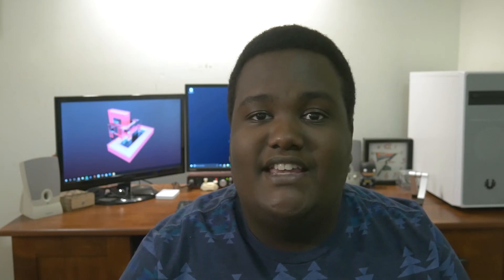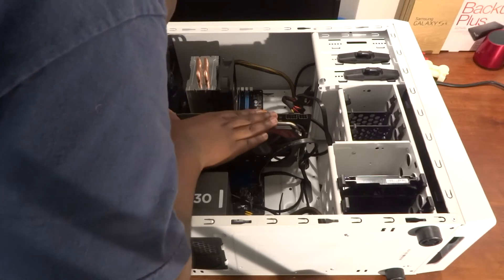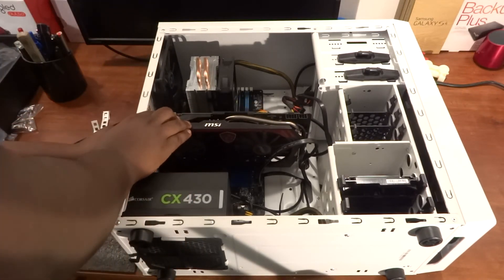The next steps are rather simple. Take your graphics card and install it into the case. To do this, remove the rear I/O slot covers from the back of the case — some are disposable and must be thrown away, while others have thumb screws. Find the PCIe X16 slot closest to the top of the motherboard, or whichever slot your manual recommends. Push down the tab at the end of the slot and insert the graphics card — similar to installing RAM, once you have the proper orientation it should go in relatively easily. Finally, screw the card down to the rear I/O bracket.